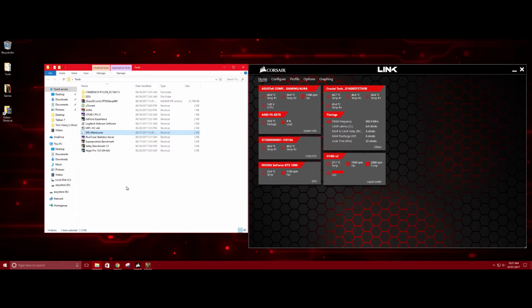And if you're starting out fresh, go ahead and move on to AM4, get you a Ryzen 5. A Ryzen 5 lowest end 1400 processor, 4-core, scores a little bit higher than the FX 8370 8-core, overclocked like all hell. You don't even have to overclock the 1400 and you're going to score higher on benchmarks, and it's also going to multitask better and be better for gaming than the FX 8370. So if you're starting fresh, sure.